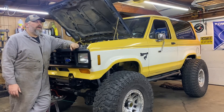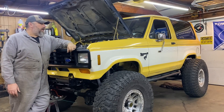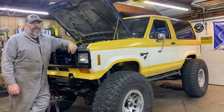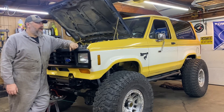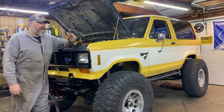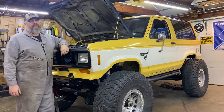In the last video, I took it for a little drive around my house, literally. It didn't have reverse — it turns out it was just four quarts low on fluid. So topped off the trans, it actually works. But the motor runs terrible. I found some issues with it in the last video. You can clearly hear it. Truck had a really bad misfire.